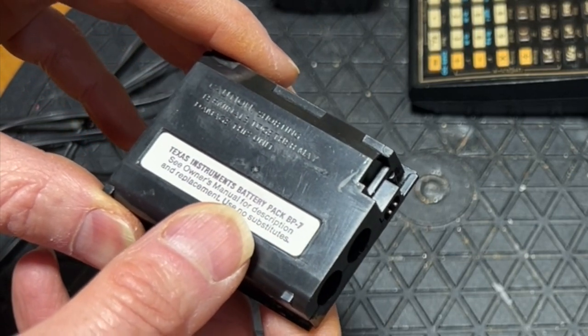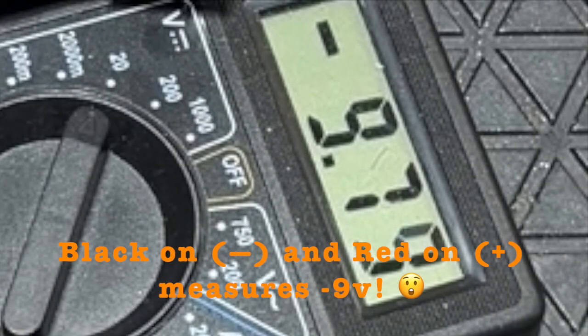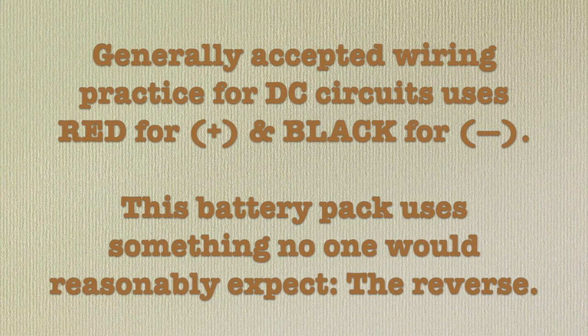What I'd like to do is eliminate this entirely. I tried connecting up the calculator to the adapter and turning it on — it doesn't power up at all. This is because the NiCad batteries are so dead that they're shorting out the converter, or because the NiCad batteries have leaked and corroded the converter, or maybe the calculator just doesn't work. I've got the multimeter rammed into the power connector, and I'm getting negative 9 volts with black on negative and red on positive. By using this truly bizarre color choice for the wires, it would be very easy to reverse the polarity, which would likely result in the destruction of the calculator. What a simple and sinister way to discourage people from using non-Texas Instruments power supplies.